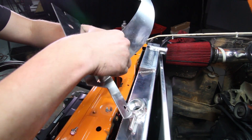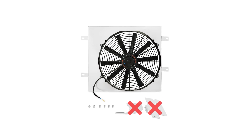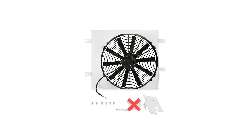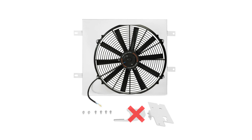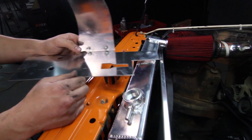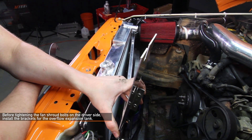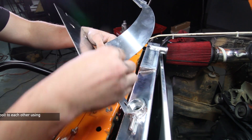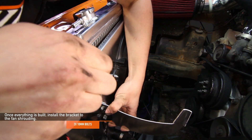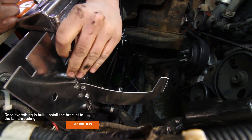We are doing this install on the 4-cylinder TJ. If you own the 1987–1995 YJ 4-cylinder or 6-cylinder models, you will not use any of these brackets — please discard them. If you are doing this install on the 1996–2007 TJ 6-cylinder, you will only use the straight long bracket. If you are doing this install on the 1996–2007 TJ 4-cylinder, you will follow this install video as shown here. Before tightening the fan shroud bolts on the driver side, install the brackets for the overflow expansion tank. The Mishimoto provided brackets will bolt to each other using the two provided 10mm bolts. Once your bracket setup is built, install the bracket to the fan shroud using two provided 10mm bolts. This bracket attaches to the side of your fan shroud.